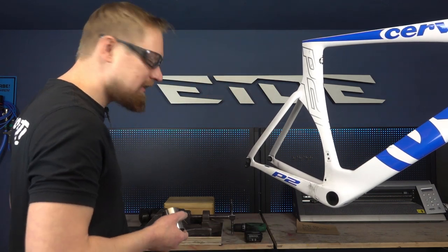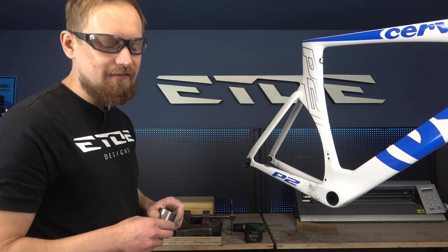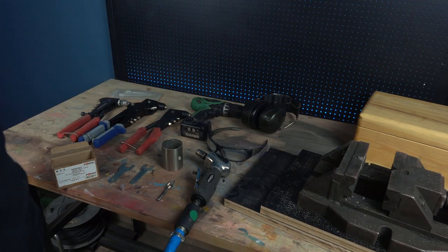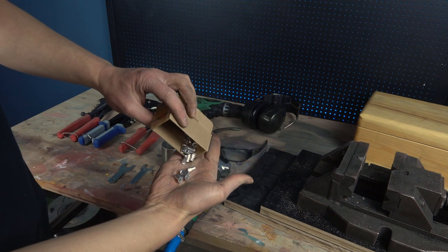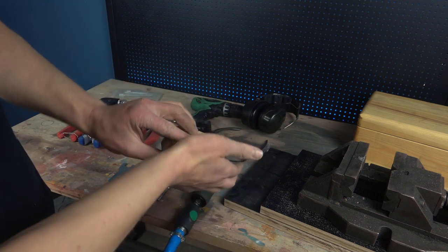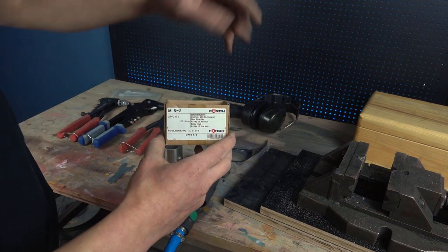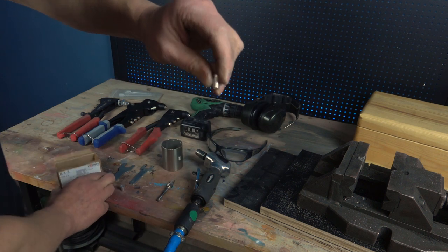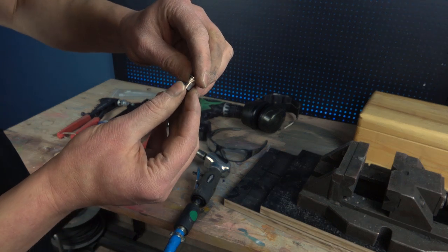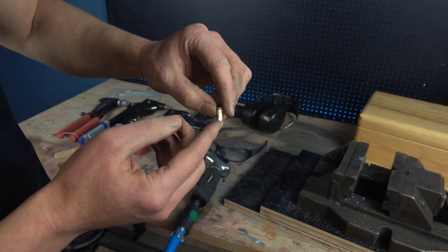To replace these rivets we need some tools, and I have all the tools here we needed. If you want to replace the rivets on your cycle frame you need of course new rivets — these are the typical M5 ones, the metric 5 rivets for the screws of your bottle cages. M5 blind rivet nuts — I will link some in the description, but make sure these are the right ones for your bike. Some bikes have different rivets and the rivets for the cable holders are a bit smaller, but I'm sure you will find the right one online.